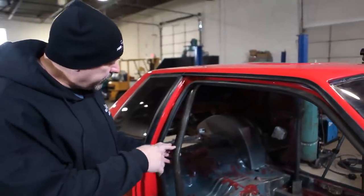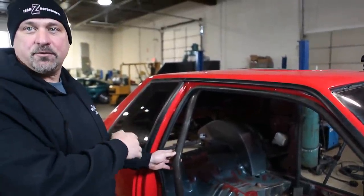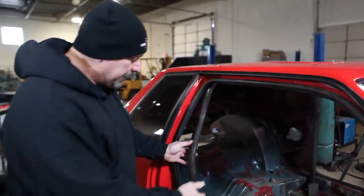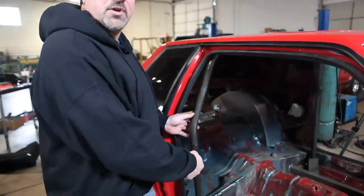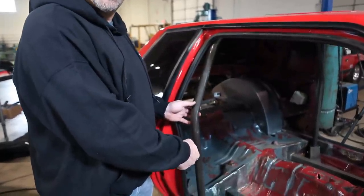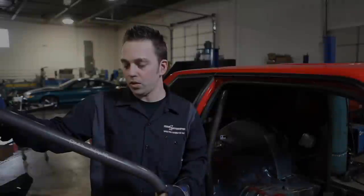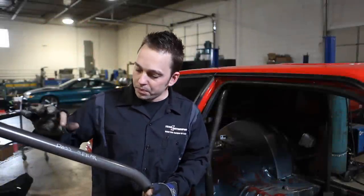It'll be clearly labeled because there is a three-degree lean back — it'll be labeled front and rear, and the front of the car is the front of the car. You'll have a three-degree lean back and the cut is already made into the bottom of the main hoop, so all you have to do is either set it on top of your 6x6 plate or set it on top of your subframe connector. We already have the main hoop tacked in place and we're going to attempt to put in the passenger side A-pillar bar, which is marked passenger side and driver side so you know which one goes where.